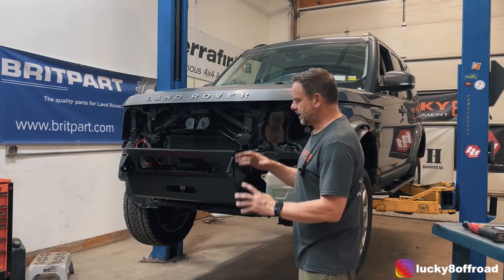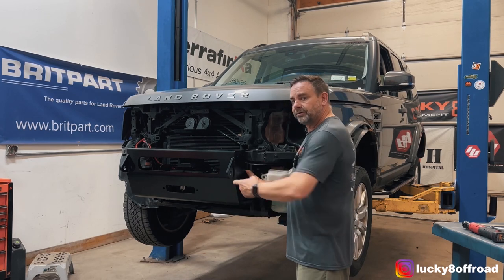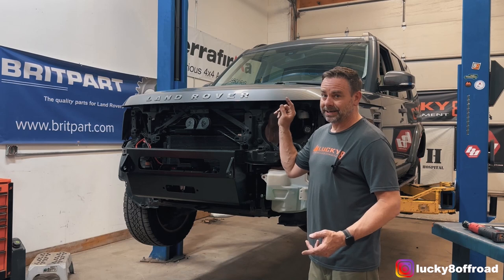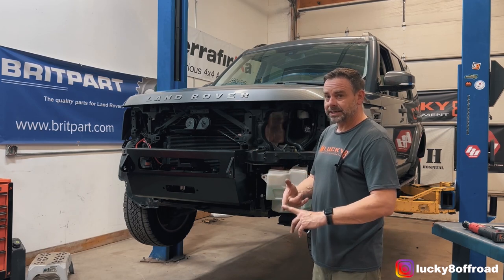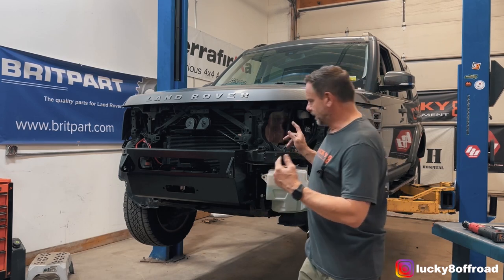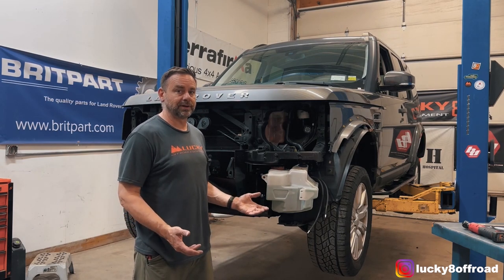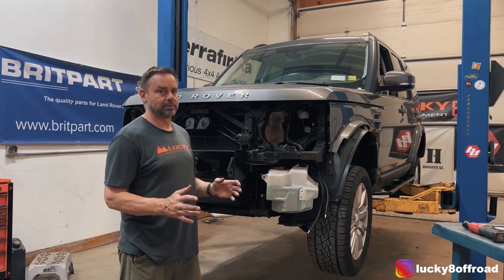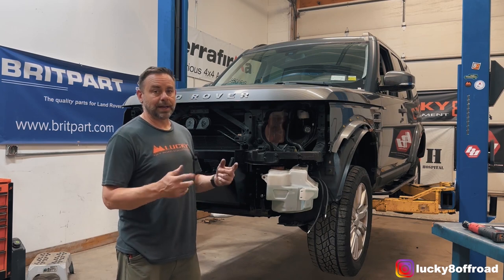A couple of things to address: if you're using the Proud Rhino bumper and balancing that whole thing up there, it's difficult. There is a hole in the front for the swivel recovery points — that's how I get that lower bolt on either side. I go through the front hole with a long extension and a swivel to get in there and tighten it down. Now, the washer bottle on the LR4 is difficult — we're going to have to remove it and use a different washer bottle. On the LR3, you can reuse your factory washer bottle and just relocate it with a separate kit.